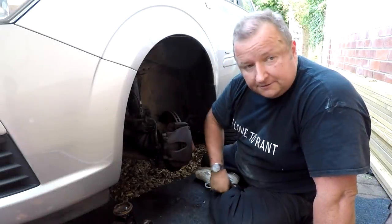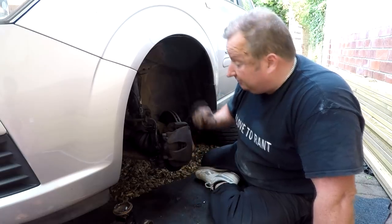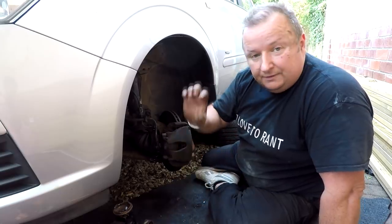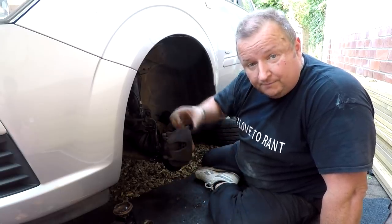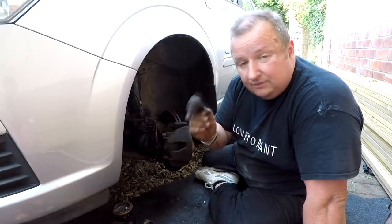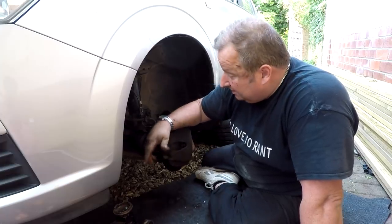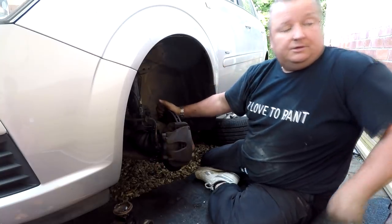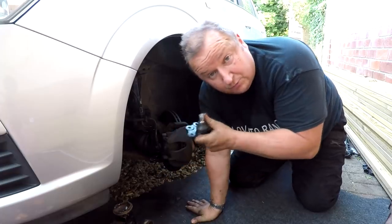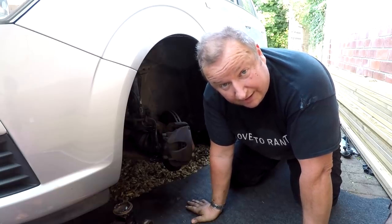What time did we start this job — just getting this bottom ball joint out? Maybe even an hour and a half. Finally out! That is what I don't like about doing bottom ball joints — this one was crimped in, we grind off the top and the bottom and try to drift the thing through, and it's taken this long. That's why I normally let garages do these. No fun when you're in this situation doing it on the floor — you want the car up in the air. Anyway, we've got it off now. The new one goes straight in with bolts, nuts and bolts. We're going to say goodbye now because I've had enough today, and we'll see you in the next video. Bye for now.